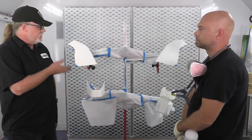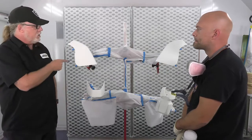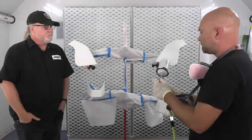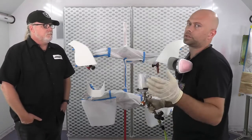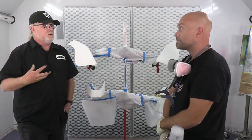Normally if I was spraying this with a solvent-based base coat, I'd be putting a sealer down like a primer. But in this situation, this is just raw plastic — the color on here is actually the color of the plastic itself from the mold. So you're putting a colored sealer down. We chose gray. The silver sealer is what I was going to recommend, but Craig doesn't want it to be super glittery. The new version, the 6013, is really bright — the old silver sealer would be perfect. The new stuff is literally like Pimpadelic Lowrider.